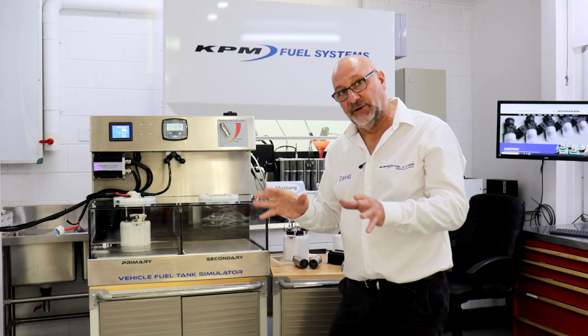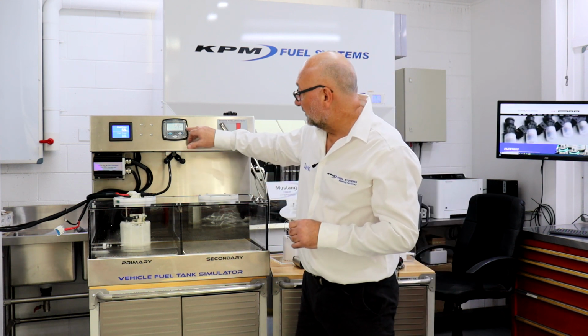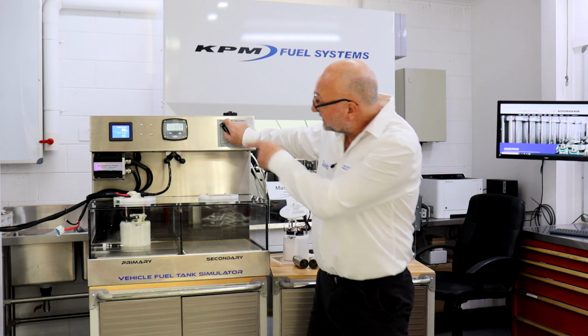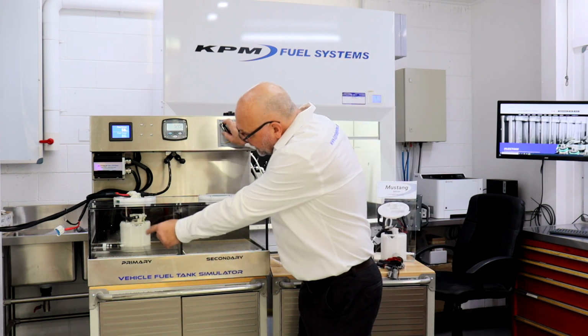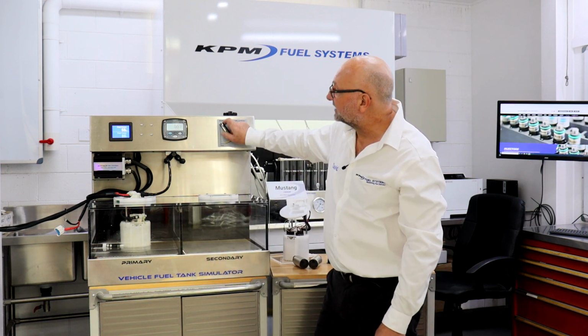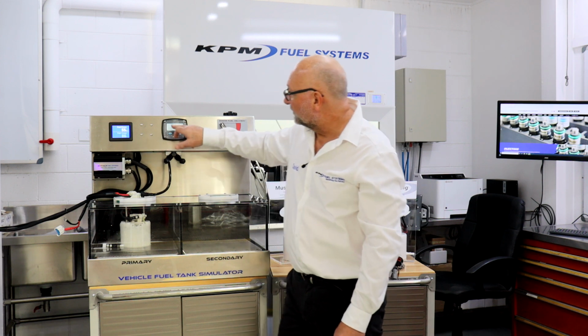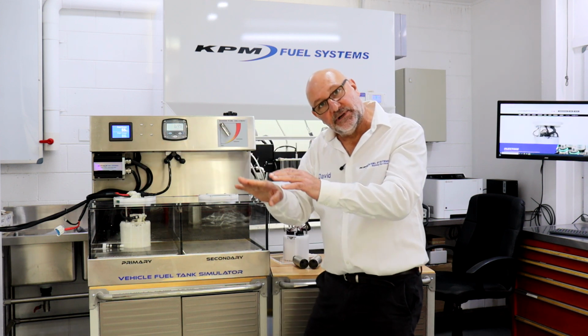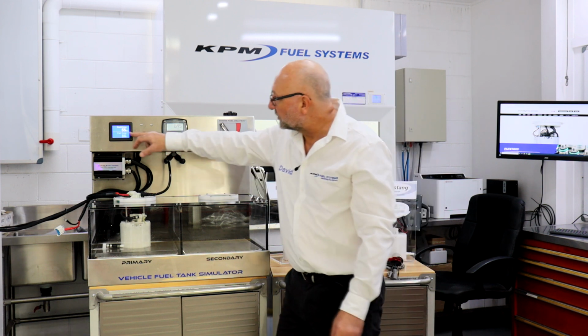Now we're talking about pump fuel here. At the flywheel, we are now supplying 1500 horsepower of fuel. We're still at 58 pound, we're still cascading. Let's max the system out. Okay, see, we're dropping pressure now. We're at about 700 litres of fuel, meaning the pumps can't keep up, therefore pressure is dropping.